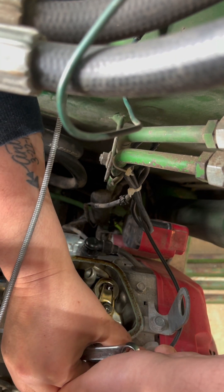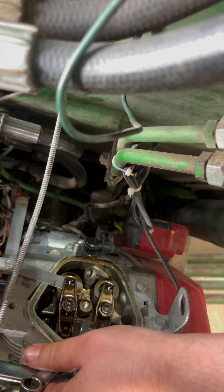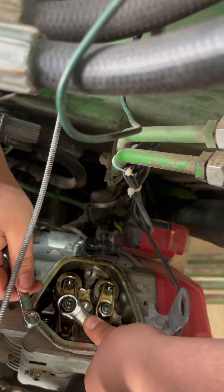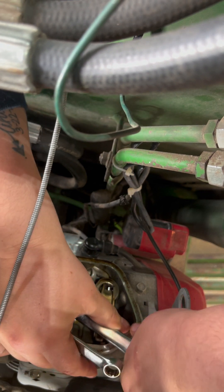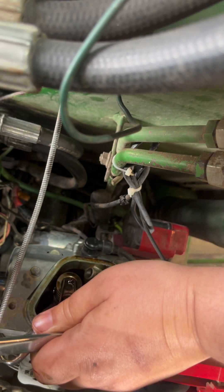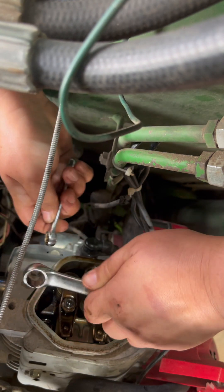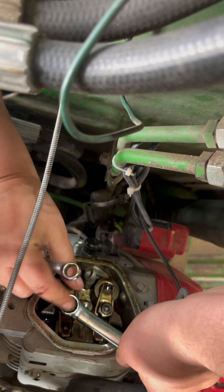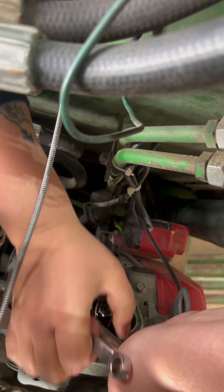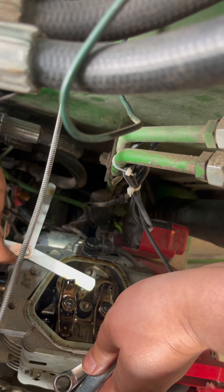Now since it was loose, we are going to attempt to tighten, and you want to make sure you have the gauge because you don't want to make too many adjustments. When you tighten this one back up it is going to adjust a little bit, so you just got to keep playing with it — that's what I've learned. It's still pretty much the same. This is 0.008 because of the exhaust.